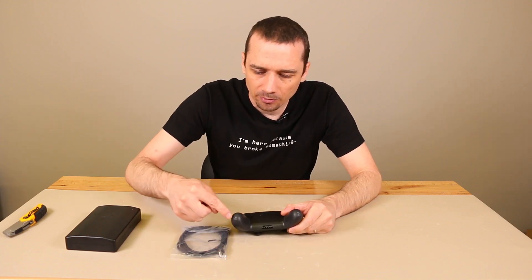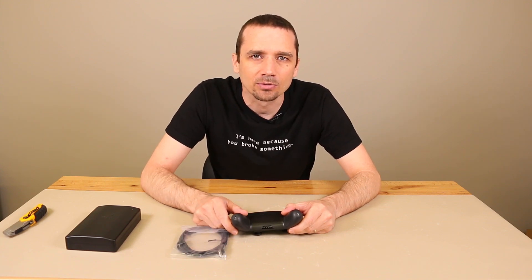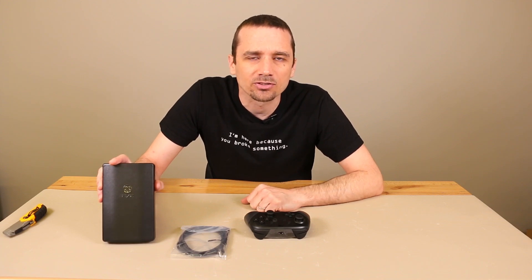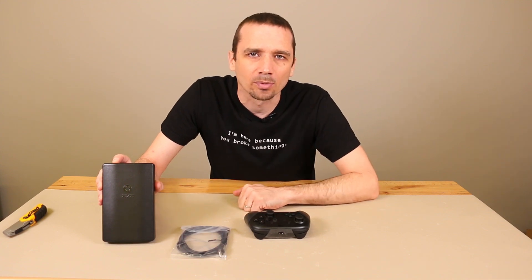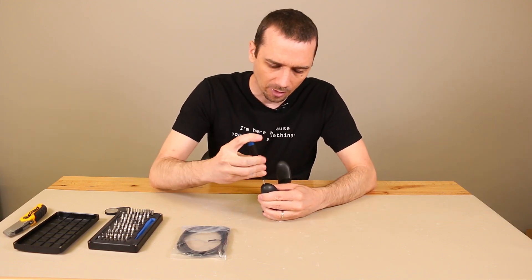The first step is going to be to remove this Phillips screw and this Phillips screw, and then see what's inside. I'm going to be using an iFixit tool kit — I'll link that in the description below. iFixit did not sponsor this video and I did pay for this repair kit; I'm using it because I simply like their tools. The bit I'm using first is a J-00, which is kind of like a Japanese Phillips bit.